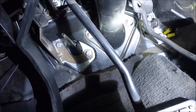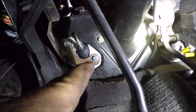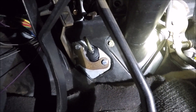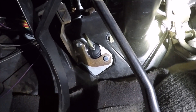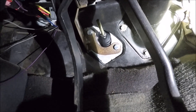Inside under the dash, here are the two 13mm bolts — right there and right there. I highly recommend keeping that bracket in place; it actually stabilizes everything including your brake bracket. Some people remove it just to make it easier, but you should keep it. It does need to be moved over slightly to get everything lined up, but you can do this by yourself — it's just a little bit of a pain. Once that's done, the only thing left is attaching the rod to the clutch pedal.